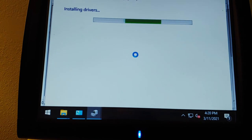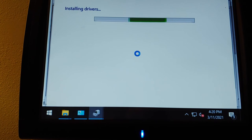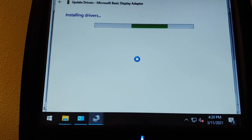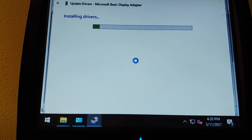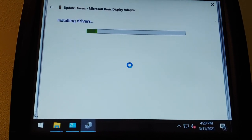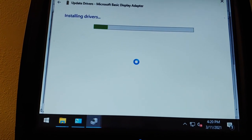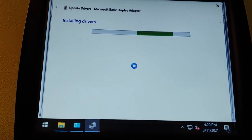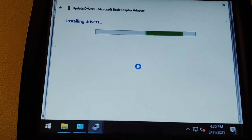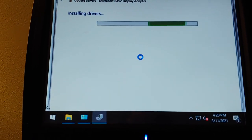And ignore the warnings if you get such a thing. If you go straight to installing the driver, you will get blue screens on startup and your Windows install will basically be useless at that point. On some computers, even going through these steps still makes your computer useless. And we'll see what happens with this one.